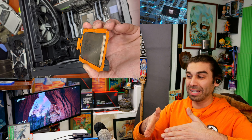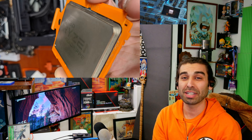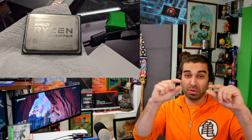The thermal paste would always blow out toward that stamp area. You'd have the little lake portion that heats up when overclocking, forming a bubble, and it would shoot the thermal paste out over the little high ridge. I figured this out because I watched their video and wanted to lap my CPU anyway — I had pulled apart my heatsink and it lightly scratched the top surface. I started sanding it out and noticed that corner started showing copper first. I used a straight bar with light to make sure the surface was even, otherwise you're just carving new CPU art for the museum, not the socket.